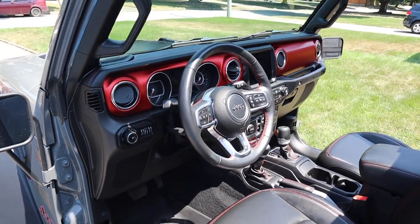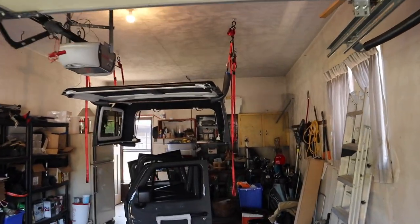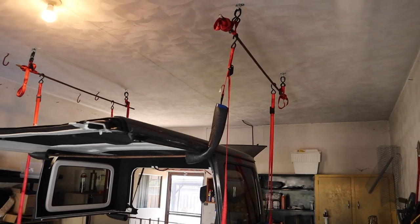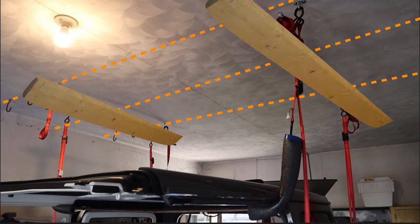We'll just walk past our subscriber's beautiful Stingray Rubicon and have a look at his hoist system in the garage. So what you have to do is back the Jeep up into the garage, and then hook up your hardtop to the four straps that come down from the ceiling. Our subscriber uses this bar in which to adjust the four straps to accommodate for the locations of the joists. If you don't have bars like this, you could simply locate the joists and screw some 2x4s to them, and then simply screw your four straps into those.